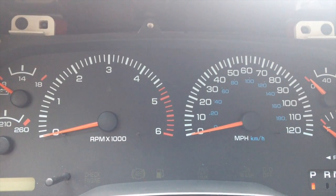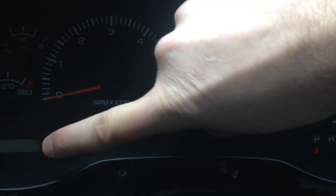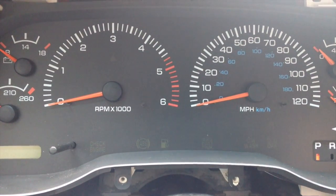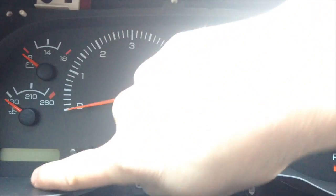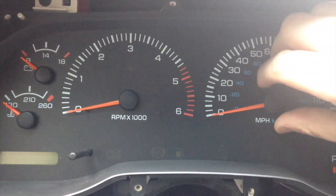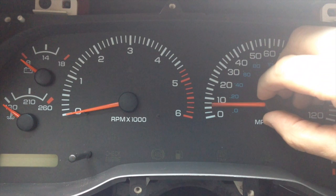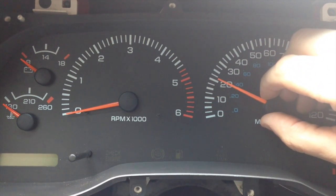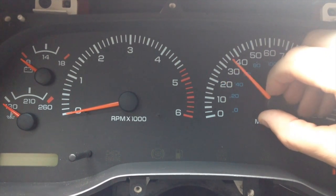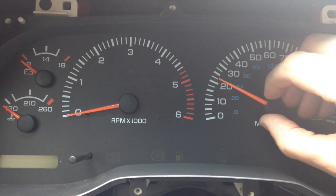There's a calibration test you can run. What you have to do is hold the reset button down at the same time that you turn the ignition on — not the engine, just the ignition — and keep holding it, and then checks will pop up right here. It's going to run a series of tests, taking the speedometer to different points: 20 miles an hour, then 55 miles an hour, then 120. It does them simultaneously, so you have to run the test multiple times.